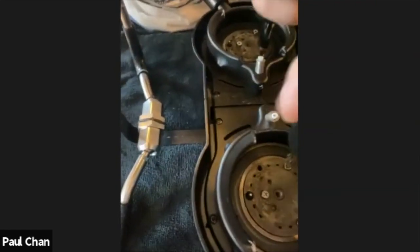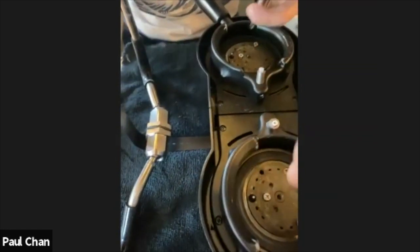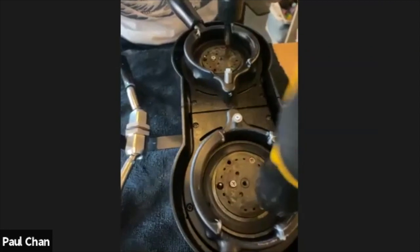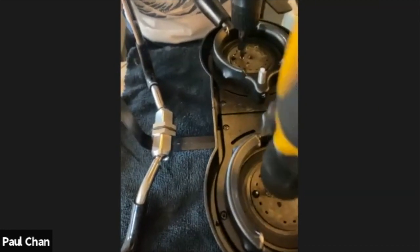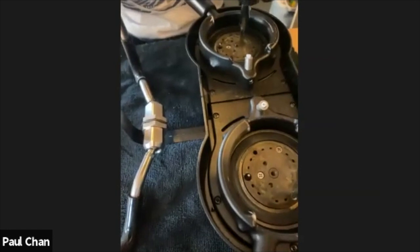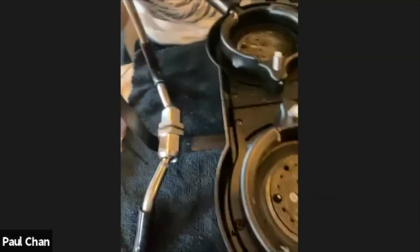All right, so let's keep it tightened. Now, I'm one of those guys that doesn't tighten them all straight away. I just get a nice little traction, torque, and then I move on to the next one, and then I tighten them all when I've finished. Now, this just makes sure that if you do have any coffee grinds under there or something, or you haven't aligned it properly, you're not just going to do damage to your brass plates. Okay. So a bit of torque there. I'm going to start tightening now. And you will find if you do it like this anyway, your screws will tighten a little bit tighter than they would. So you don't need to tighten as tight as you normally tighten a screw.